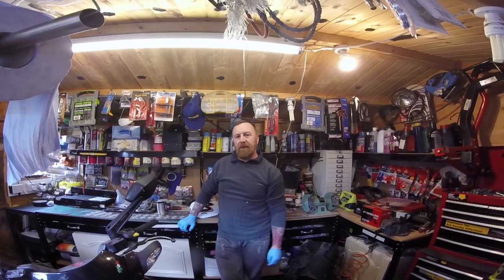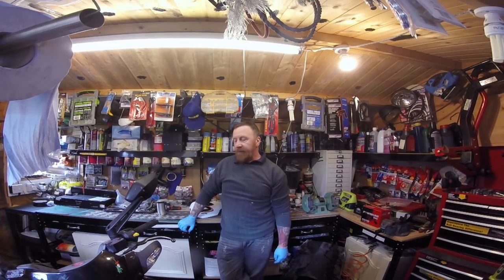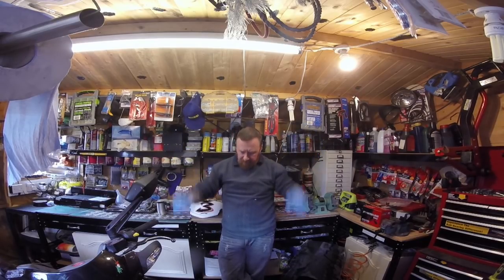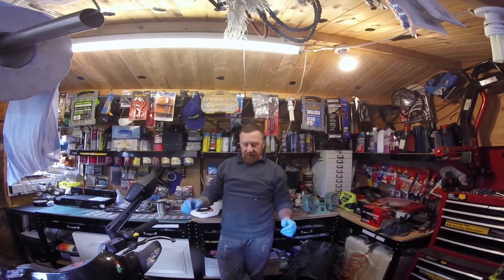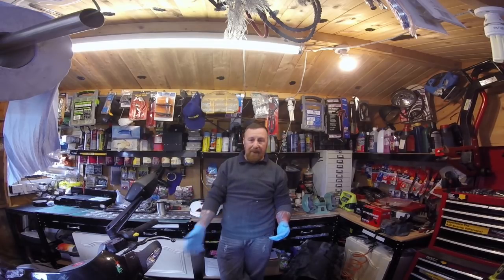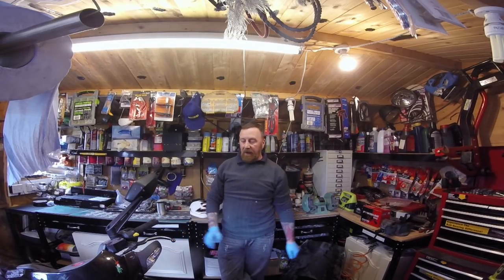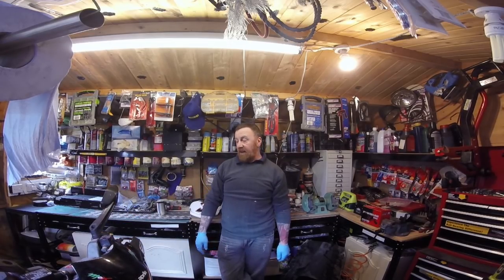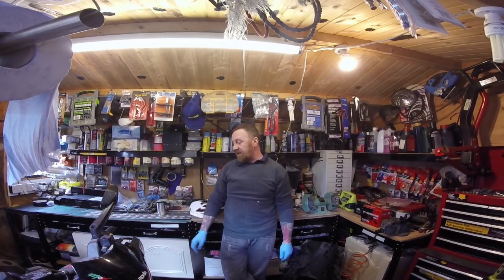Yeah, I've seen this sort of damage before when people are doing wheelies. They go up, all great, lean on the back. When they come down, it comes down with such force that the suspension comes right up, the belly pan splits, everything falls apart, and the headstock goes. It's not twisted, but this is what I'm assuming the last owner did with this. The tail light's gone on this as well.